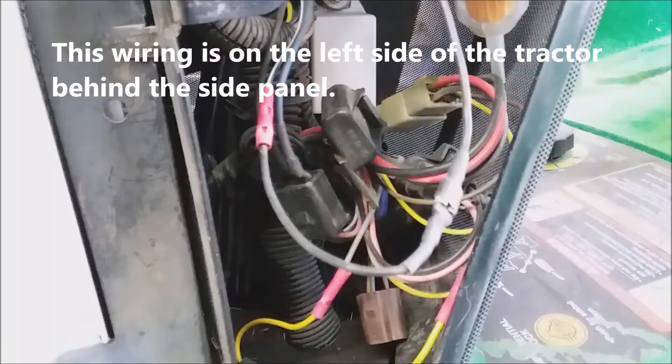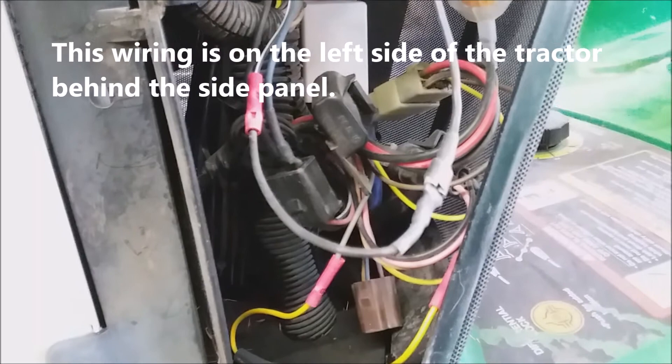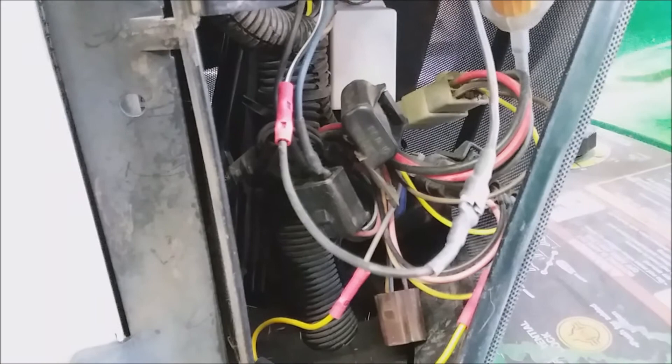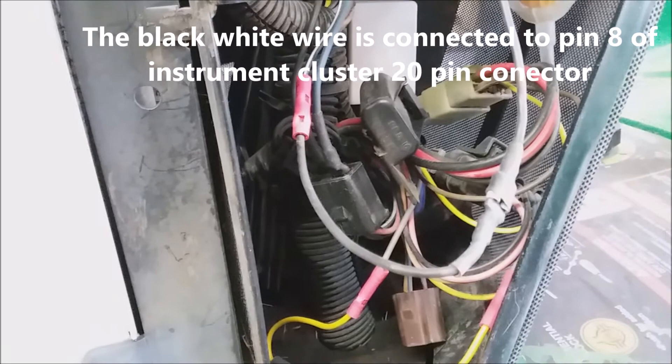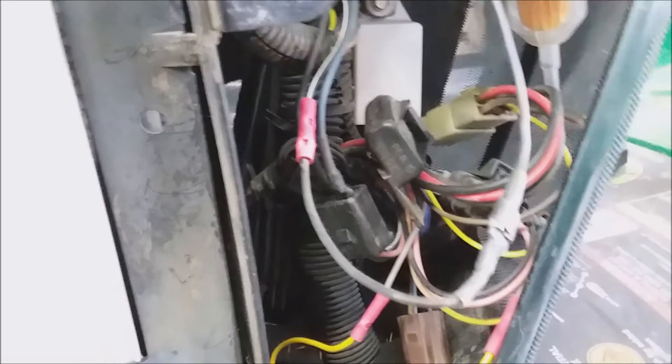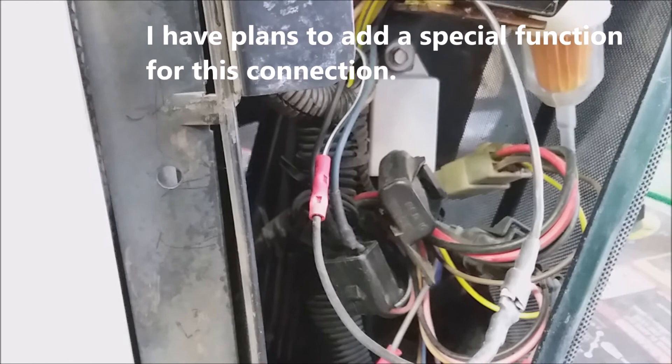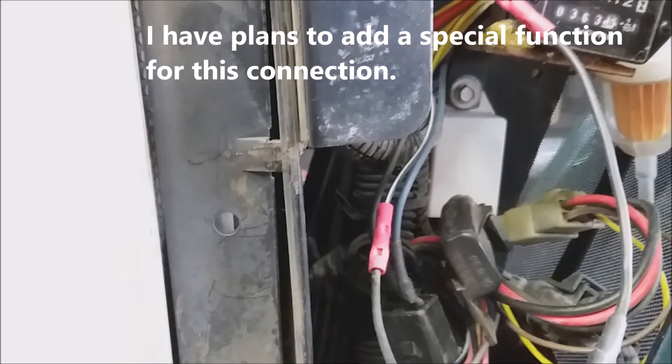What I've done here is add a connection on the black-white wire, which is the control lead going to the fuel sensor in the fuel tank. This way I can open up the circuit without having to take the fender deck off to get at the connector on top of the fuel tank. By unplugging this, all I need to do is connect ground going to the fuel gauge in the instrument cluster — it will read high if there's no ground connection, and toward empty if there's a high-resistance connection.